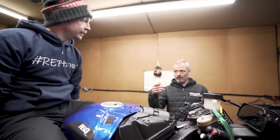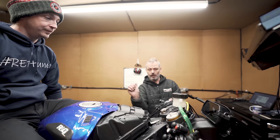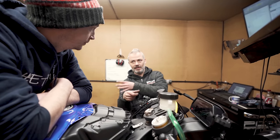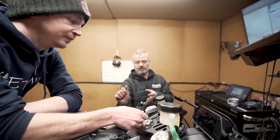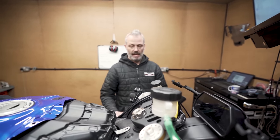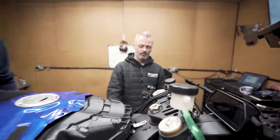It's not only that. You're on about a rider wants 100%, and on the Motec it gives him 100%. Yes, there is that aspect of it, but also, riders think 100% throttle means you're going to be propelled forward faster because you're opening it more. Well, that's not always true, especially on a superbike. With the older stuff where it was a one-to-one throttle, if you could progressively open the throttle at the optimum gas speed, it would be faster than just whacking it open. And this is what fly-by-wire throttle is great for, because you can ask for 100%, but the electronics go, well, we know that at 100% here, you'll actually reduce the power slightly. Yes, it isn't peak efficiency. So it's about getting the gas speed optimised at all times, and Yamaha have done all their calculations, and they know better than anybody else what this engine wants at particular RPM and load. So for me, that's the beauty of fly-by-wire.